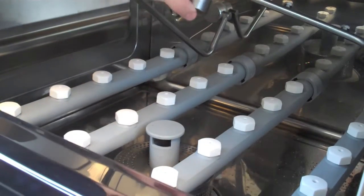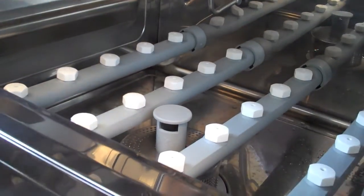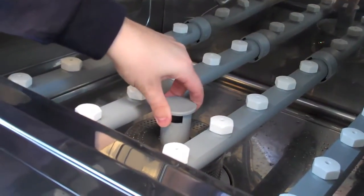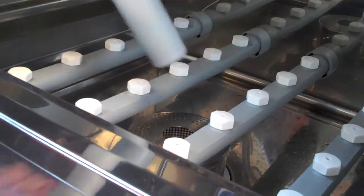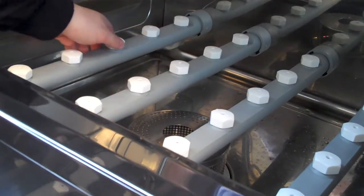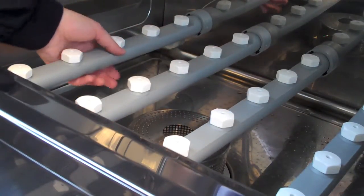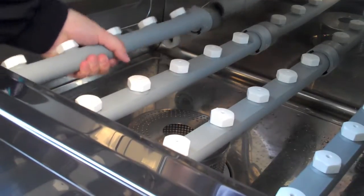The spray arm is mounted on a hinge, so it'll be easy to push up. After that, remove the overflow tube from the center cavity of the machine. Begin by removing the spray arms — give each one a quarter turn to the left and then pull from the front out towards yourself.